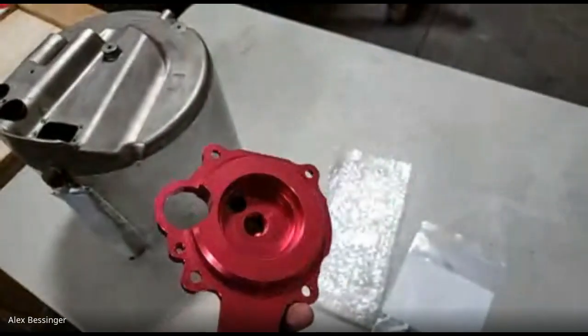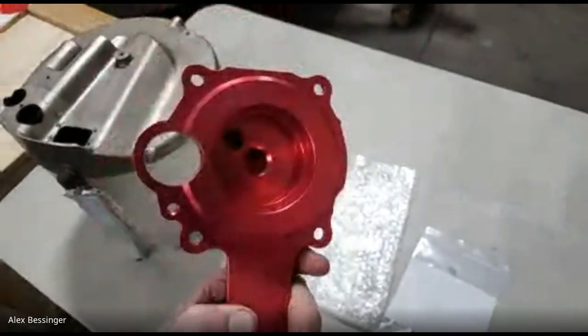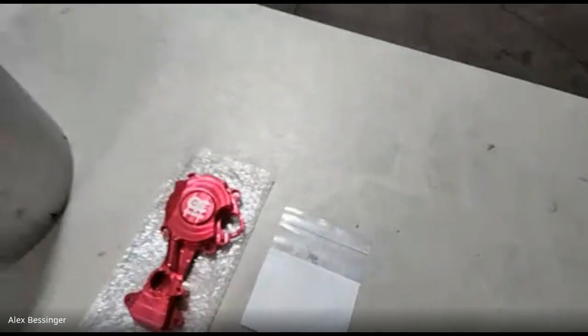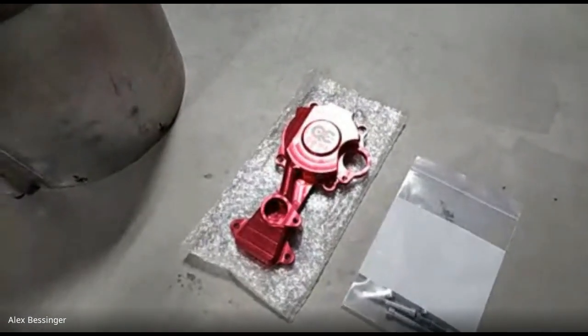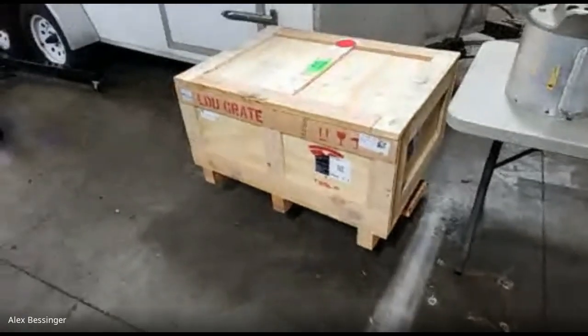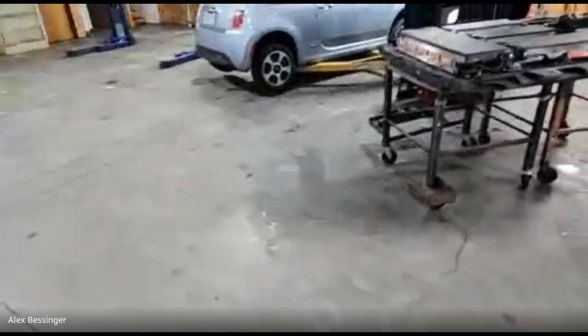But in the case of what we're doing for most of these, we're just installing this as it is and just deleting the rotor cooling. It's actually kind of a little bit of a copy of Tesla's newest large drive unit revision, which is the Revision U, where they have started doing the rotor cooling delete on their own for replacements. And that's actually what Ray got here when he had his drive unit replaced. He got the new rotor cooling delete revision. It's only been out for about 4 or 5 months now.